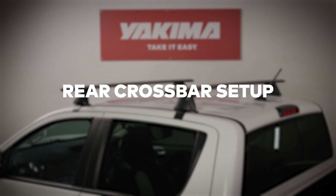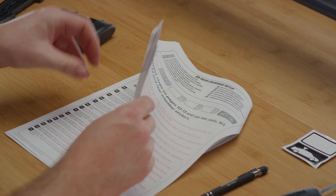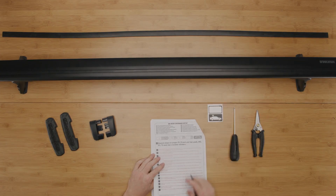Now repeat the steps we've completed for the rear crossbar and use the pads from your rear base clip kit. Set the M3 and P2 measurements, apply the T2 setting, and apply the rear left and rear right stickers to the legs.